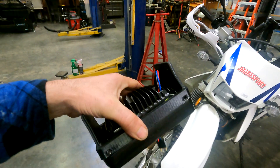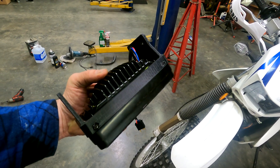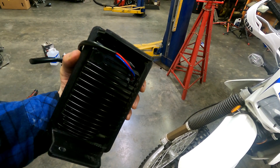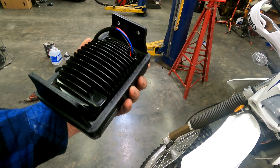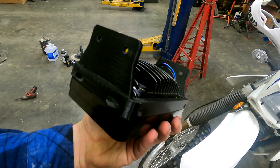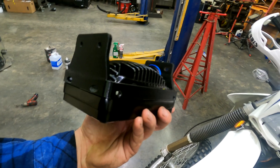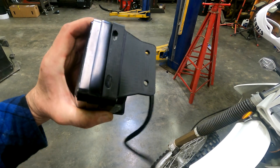When I got the Morimoto light in the mail, I immediately realized the back was curved and completely different from the cheap Amazon light I'd previously designed a bracket for, and it has no mounting holes. So I've already got a bracket mounted to it. I designed this in Fusion 360 — it's basically a halo that slides over the heatsink on the back of the Morimoto headlight and covers the four diagonal stiffening braces. I 3D printed holes in the corners, then ran a drill bit through the aluminum back housing fins — those stiffening ribs — without perforating the inner housing, so there's no risk of letting moisture in. Then I ran screws through and tightened them down with captive nuts on the outside. I printed it in ABS so it'll be resistant to temperature swings.